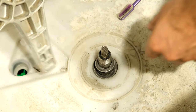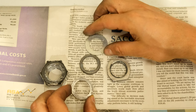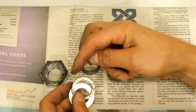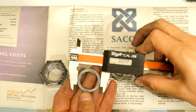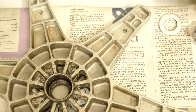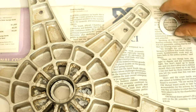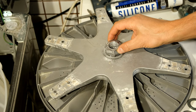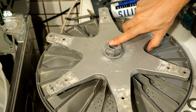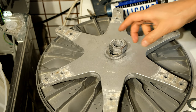I'm putting this first washer that I've made — it can still move since the shaft is gouged, but it will raise the plate and that will solve the problem. This is the original washer which I'm putting back. I filed the inside bigger and used an angle grinder to cut the outside. The washer that sits towards the bottom is 33mm — that's important because it's got a slot in there, and the one I've made also has to slot in there. That washer goes there, then the nut goes in place. But this thing still moves because inside it's quite worn and the shaft from the motor is also worn.